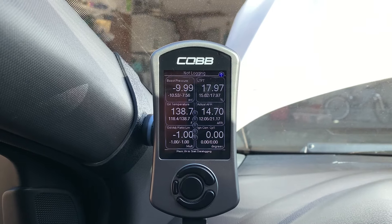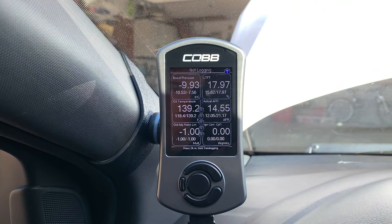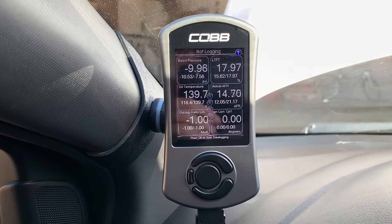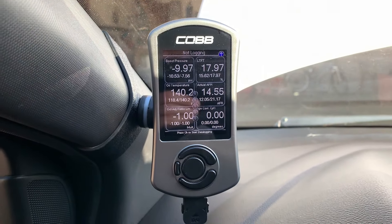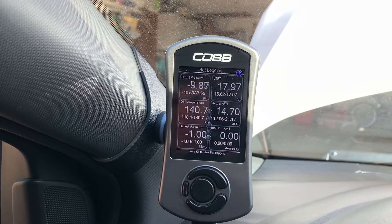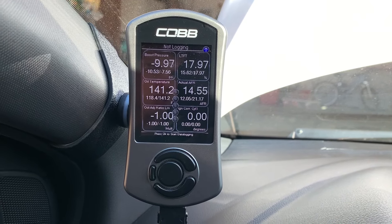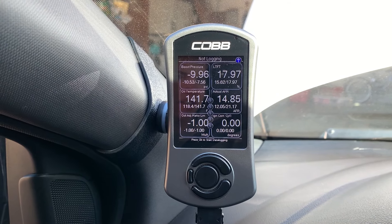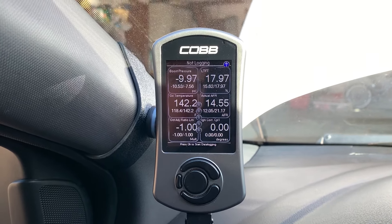Especially if you live in a cold area, I usually let my car idle for a while in the morning to get the oil warmed up. That's a good way to monitor where it starts and where it goes, because that is an accurate number. Here is the octane adjust ratio — you definitely need that if you have an E30 tune, but also just for any tune, because it shows you the quality of your gas. It should be negative one if your gas is perfectly fine. If it goes under negative one or changes to a different decimal, that usually means you have bad gas or your E30 mix isn't completely accurate.